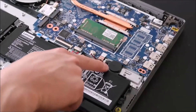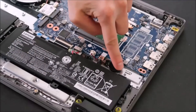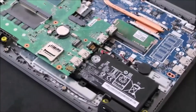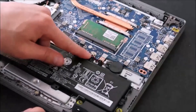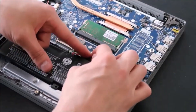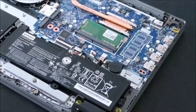The third and last test in this video is how to perform a manual BIOS reset by temporarily removing your CMOS battery from your motherboard. This is your CMOS battery — it's a little round component that looks like a watch battery inside, wrapped in black electrical tape and plugged into a port. Another common CMOS battery presentation is a coin-cell type mounted directly on the motherboard. All you would do is unplug it from the port — don't pull on the wire, just put your fingernails on either side and slide it out. That's a BIOS reset — leave it unplugged for a while and then plug it back in.